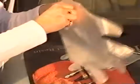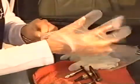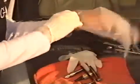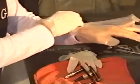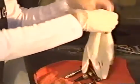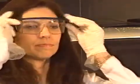Avoid resin contact with eyes, skin, clothing, or painted surfaces, and work in a well-ventilated area. For proper hand protection when using Tri-Glass resin, an effective barrier is a polyethylene glove next to the skin, with a latex or vinyl glove over the top for dexterity. Only use chemical-resistant gloves like polyethylene or nitrile next to the skin. Protect your eyes by wearing safety glasses.